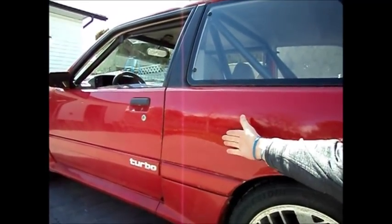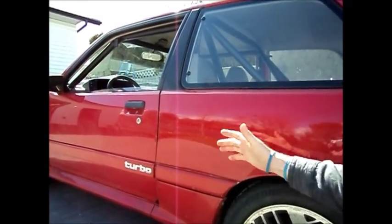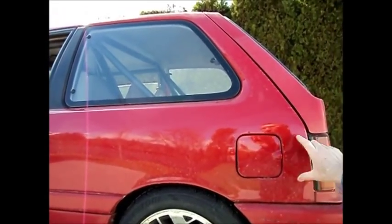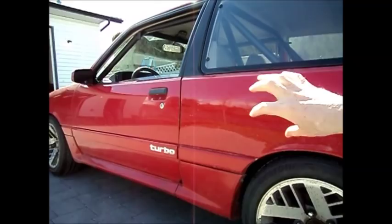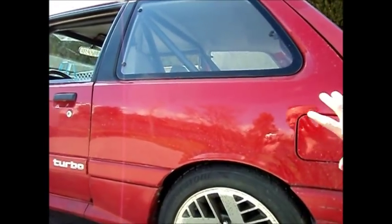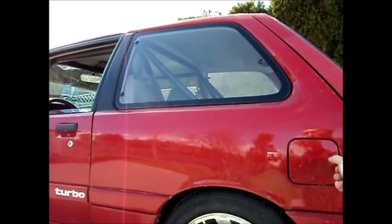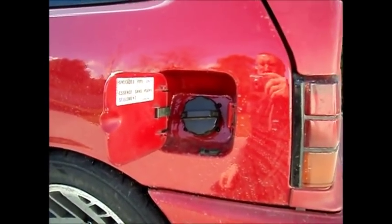The Firefly's gas tank used to be under the back seat and filled here, but there's no room under the back seat because there is no back seat — that's just rear suspension. So it's moved here. I cut out a square, traced that square over to there, cut out the fuel filler door, re-welded it here, put the patch over there, moved it back and forth. The fuel filler's right there, in all of its original equipment glory, in a completely different place. It still uses the factory GM fuel injection computer, so it's all factory and original equipment reliable.